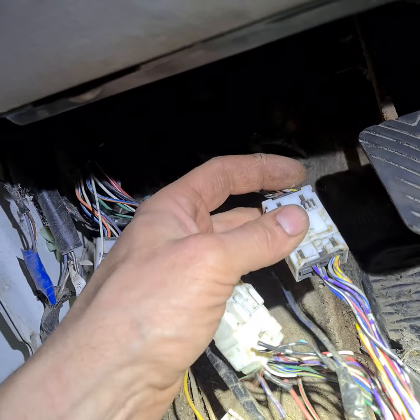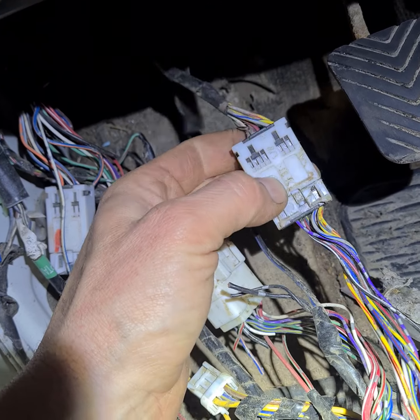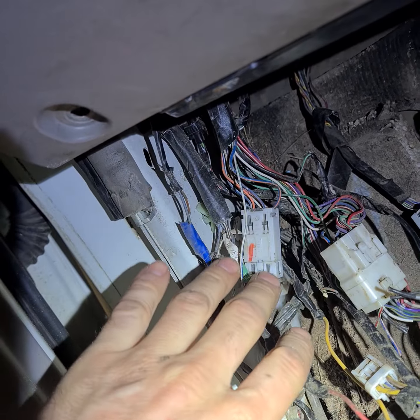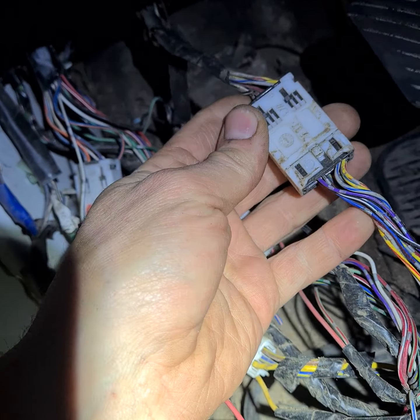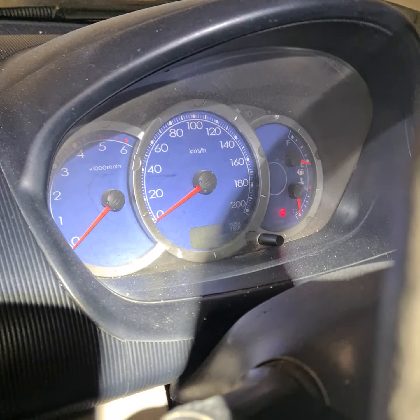But in this corner I found a rusty connector under the plastic. I took it out, cleaned it inside, and all was good. I connected it back and got plus, and finally the instrument woke up — the speedometer is now working.